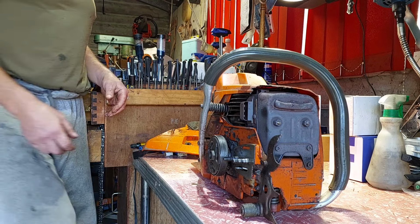We've got the stand, so you can see it closer up. Worth knowing, I have had this problem before with my Stihl 090. I replaced the crankcase housing on the PTO side, so it's red, and I blew air through it. I think this one's got the same problem. Wear gloves and glasses when you do this, guys. Now, if you look at that hole, there's corrosion there, then there's a hole through here, a hole through there. I would say maybe I have a hole in the oil pump. So it was coming out here, just by blowing it.